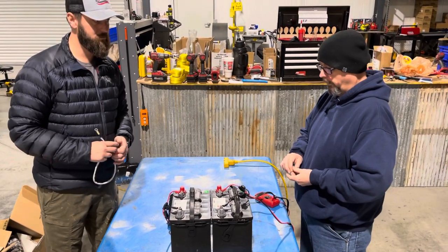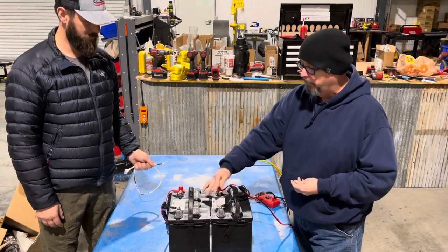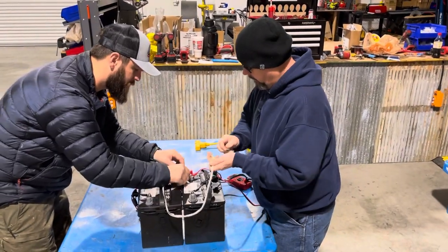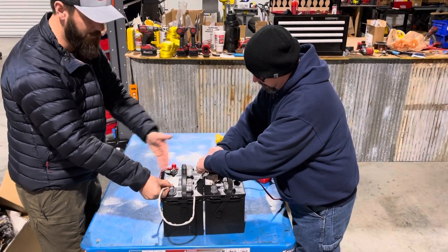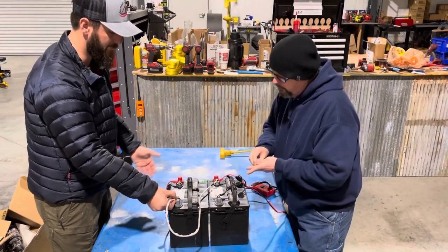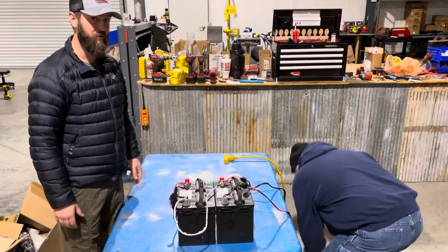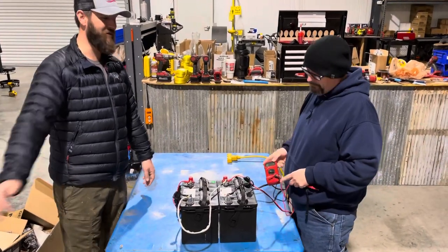When you wire in series, rather than increasing your run time, you're adding 12 volts and 12 volts and ending up with 24. You carry a wire from the hot side on battery number one to the ground on battery number two. You can keep doing this — you can get 36 volts, 48 volts, basically build a golf cart. This is how they make larger run time things and larger voltage pulls. There are whole channels out there where dads take their kids' little Power Wheels car that runs off 12 volt and make a golf cart out of the thing — run it on a 36-volt bank, put rubber tires on it. These little kids are zipping around at 18 miles an hour in a plastic buggy.